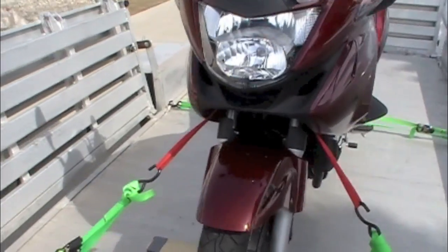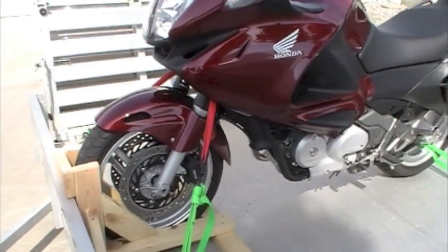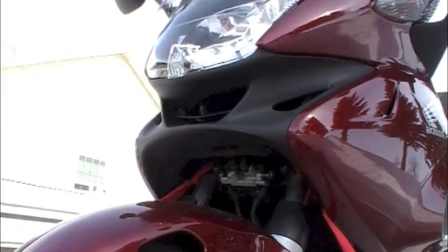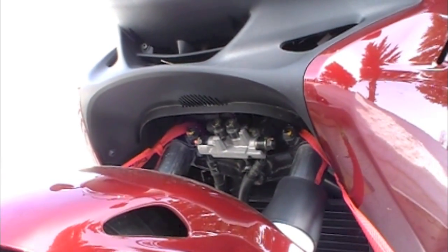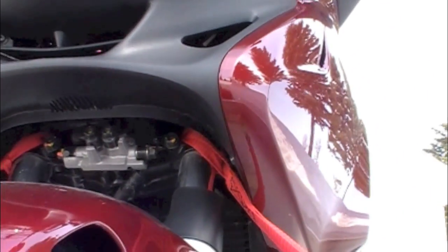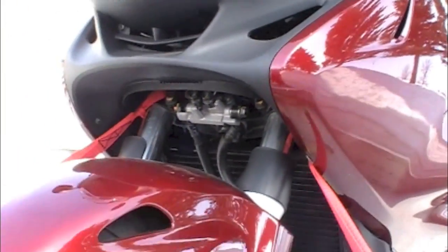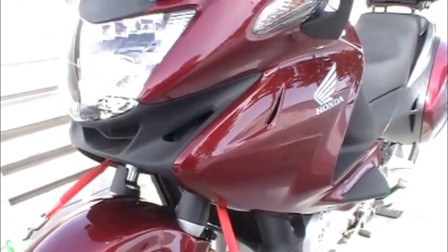You also need to secure that rear tire. I did two straps — I wrapped them around the tire and out to the side and tightened them up, which kept the back end from swinging around. You can see underneath I just wrapped the strap around the frame, making sure to avoid any wires or tubes, staying on the metal only, then go through the loop, pull it down, and attach your metal hook to the other loop.